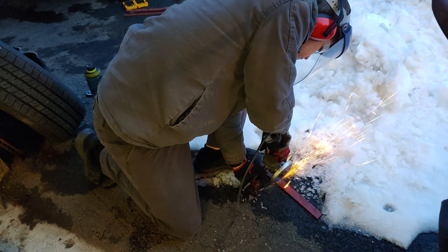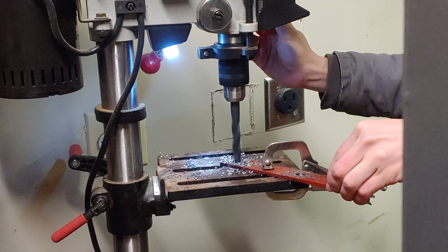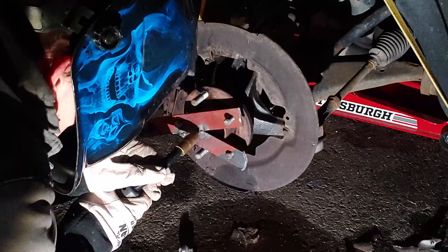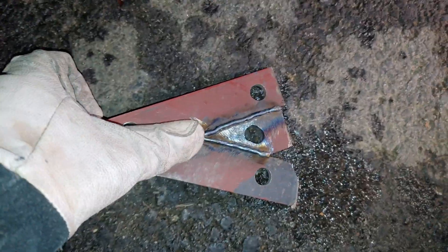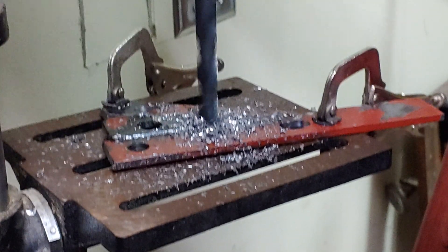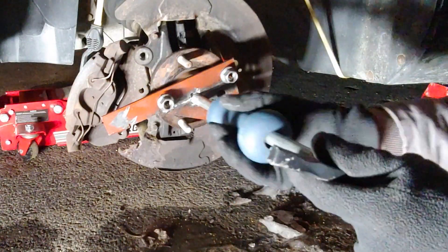I have a lot of this material and this goes right in the middle. That's how I'm going to weld it. The scrap triangle fits perfectly in between these two, so I'm going to weld it. This is done now. I'm going to find the center of this and drill a hole there so I can put my slide hammer through it — just like that. I'll tighten it and slide hammer it.